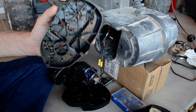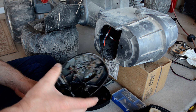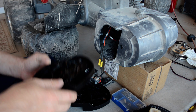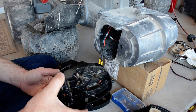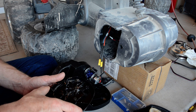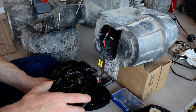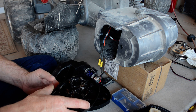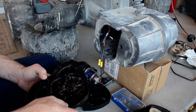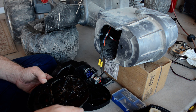When they sent me the first case full of grease like this, I was not happy. I spent 45 minutes to an hour cleaning it all out — getting all this garbage grease out so I could put their good race grease in. The only reason I cleaned it is because you can't mix greases. I don't know what lubricant they're using, but you're not supposed to mix greases. So I got it all clean, put it together, and it did exactly the same thing the first one did.